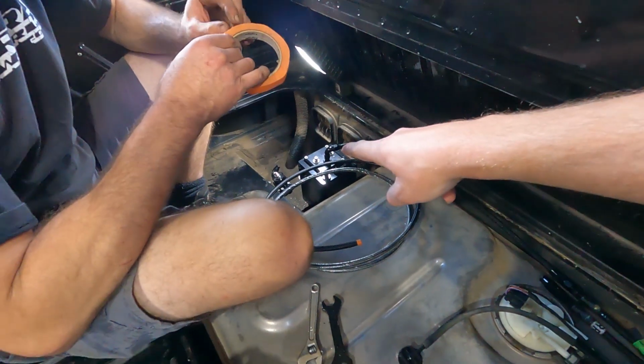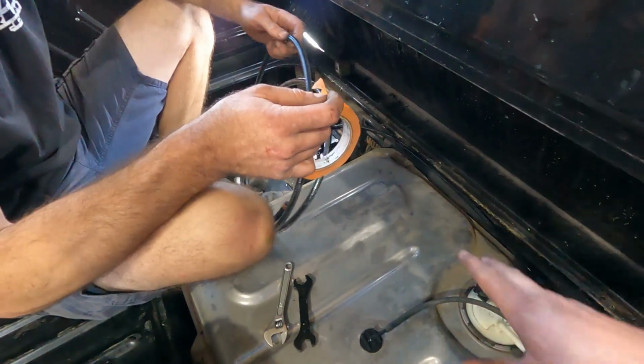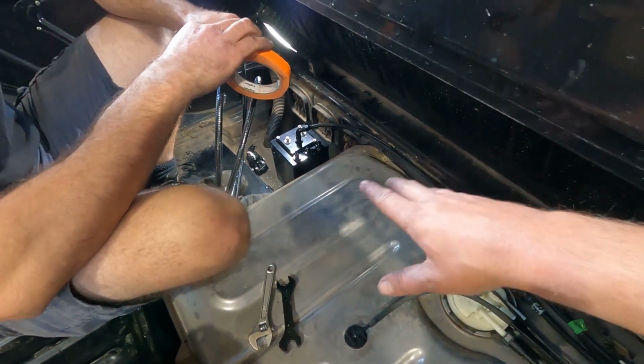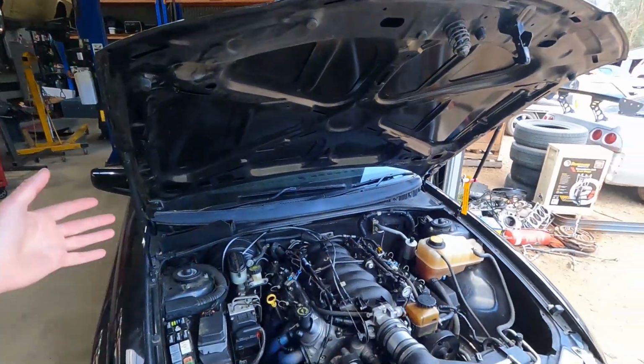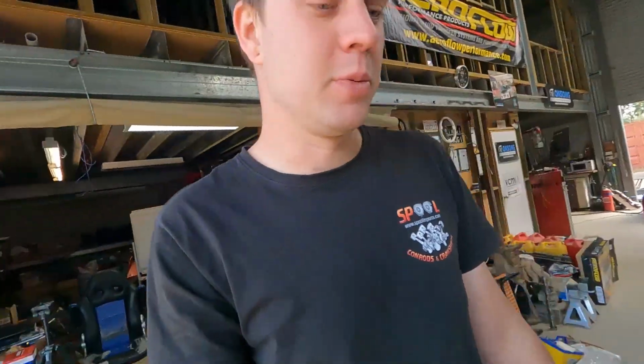We've got an adjustable fuel reg, and that returns right here at the back of the tank, and then it's still just a deadhead setup from the surge back up to the front. There's a Raceworks 340 lph pump in that surge, which would be plenty to do exactly what we want with this car. And we don't have to do much at this end, where we've already done injectors. So at least this way it's done.